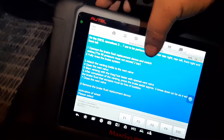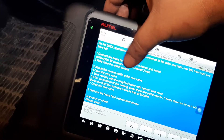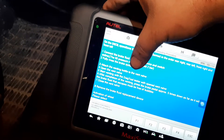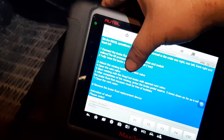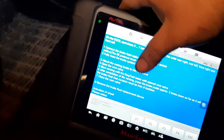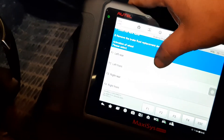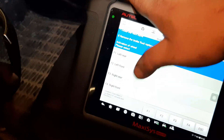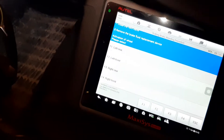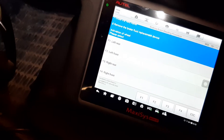Right away the tool tells you to connect the brake fluid replacement device and not to exceed two bar fill pressure, and to fully rinse the brake system and attach a venting bottle. That's once you're at the actual calipers on the bleeder nipple. Always go right rear, left rear, right front, then left front last. We ended up going around two times to get a bit better result. After that I test drove it and the brakes were perfect.